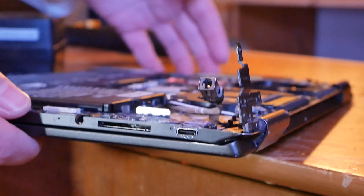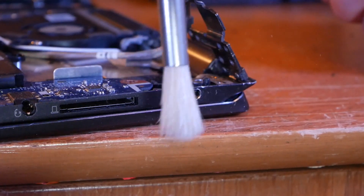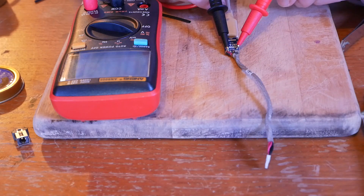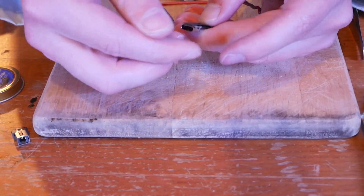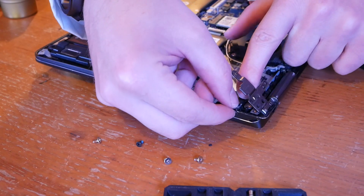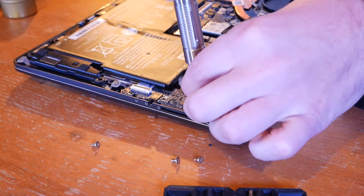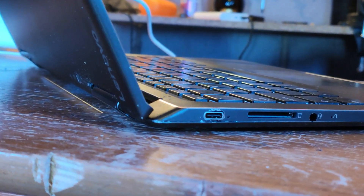This is the final job and it doesn't look bad — there are a couple of scuffs where my dremel slipped, but it looks alright. Now it was time to change the cable; it was just two wires so it's a very simple soldering job. Once the soldering was complete I tested the cable to make sure it's alright, then used a piece of electrical tape to isolate it. I had to use a couple of extra strips of tape to create a bit of tension between the retaining mechanism and the USB Type-C module. Once I screwed in all the screws, the socket was secured in place.